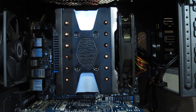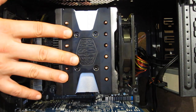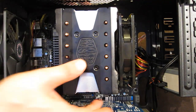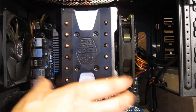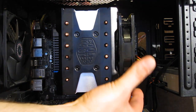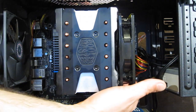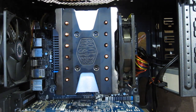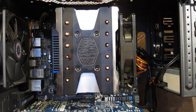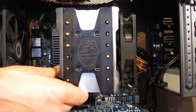Not a small cooler, not a gigantic cooler. It does stand tall at 163 millimeters, so you'll need to check clearance. There's good space around the cooler itself — it doesn't have a really wide footprint. The fan does, but you've got good clearance over the RAM slots, so with standard size RAM it won't be blocking anything. The fan runs 800 to 2000 RPM, giving you a choice between quiet or extreme cooling. Nice, quick, clean, easy installation.